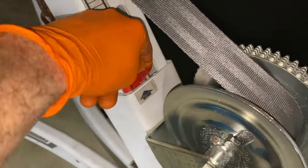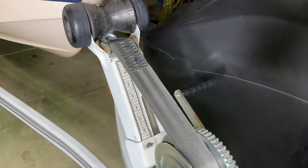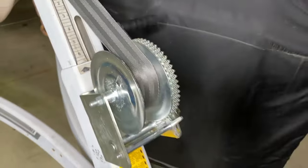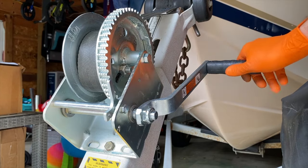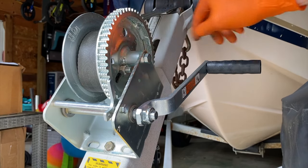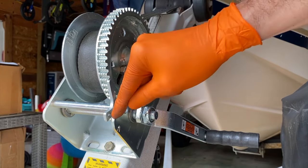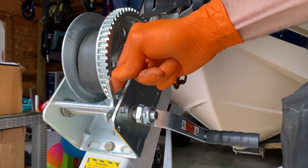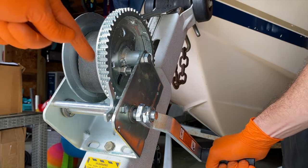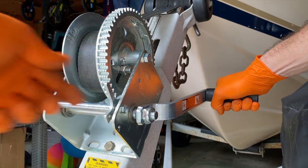Coming back starboard side — the very last thing I'm going to do is remove that tape. And that is it, DIYers. We hope this helps. Do us a favor: below the video you will see the thumbs up icon — click that, like the video, subscribe to the channel, and definitely ring your YouTube bell. One last thing before we wrap up: I want to show you how to operate the wind and unwind mechanism. Right now we are in the up position, winding the winch tight. When it's time to launch the boat and reconfigure the lever to the unwind and down position, keep your hands away from the gear. If you push on it, it won't go down — carefully grab your lever or crank and apply just a little bit of clockwise pressure until it shifts the lever and you can then push it down. Then you can unwind your strap and launch your boat.